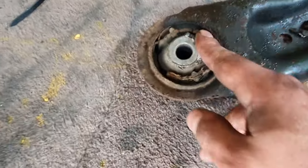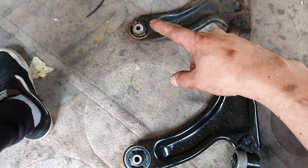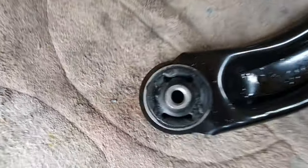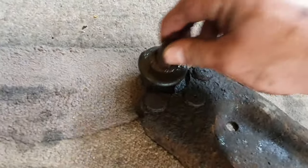This is miserable - I hate working on cars in the rain. The Corsa is a really badly designed car. If you've ever worked on a Corsa B, which is one before the Corsa C, you'll see why this one is so rubbish. Anyway, on closer inspection it's actually worse than I thought. This bush looks absolutely worn - you can see it's at a slightly different angle to the new one. That's the new one and that is the old one. The car will handle a lot better with the new one. You can kind of see the bulging - that could be a knocking noise.